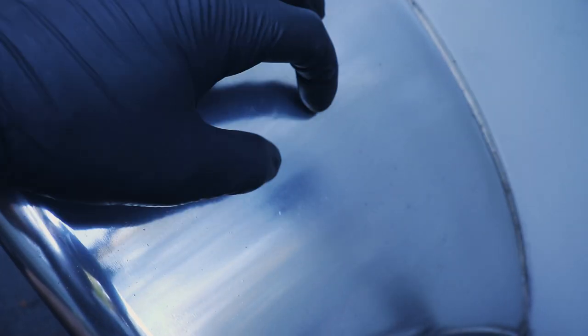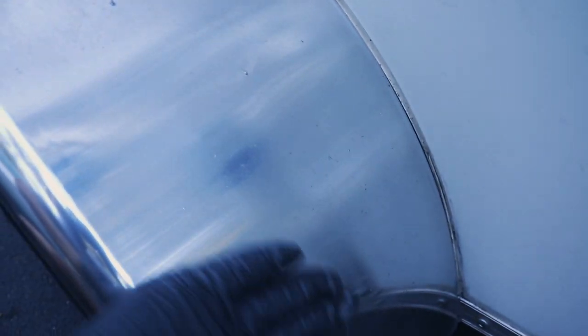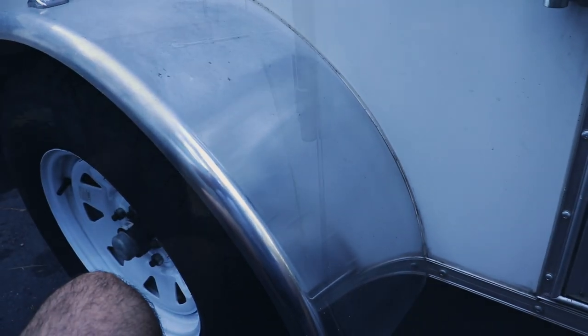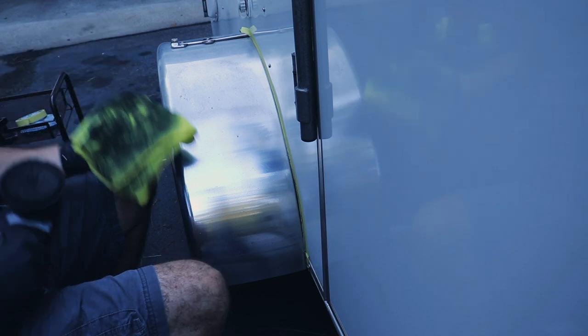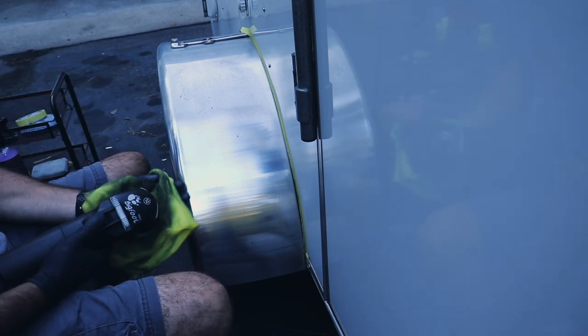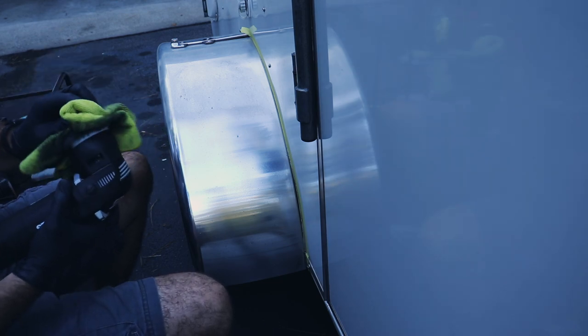Oh that is messy, but that looks nice. First initial cut — look how much gloss came back! You can see the distinct line; the edges look really nice the way they reflect the light. I'm going to tape off these edges because I need to get kind of close and it's going to mark them up. Huge improvement already. I can probably bump up the speed a bit and get a better cut. I can feel the difference — let's tape up the edges and go a little more aggressive. The pad probably needs to be cleaned out. Here's how you clean a pad — that gets most of the gunk out.